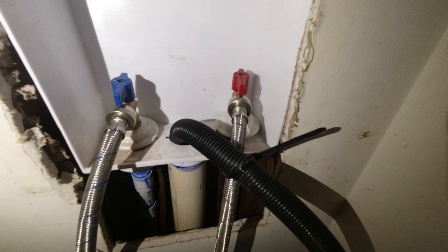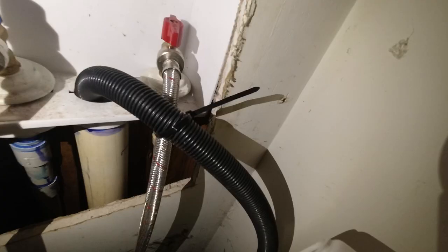Also while I'm at their house delivering, I will zip tie the drain line going to their main drain for the washer. I'll zip tie it usually to a strap or whatever's close by. Especially on newer washers, the holes are very small, there's a lot of pressure, and it will launch out like a little rocket and spray all over the wall or just land on the floor.